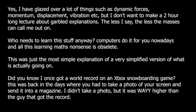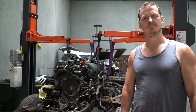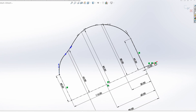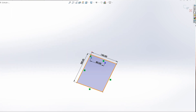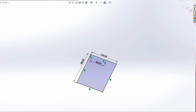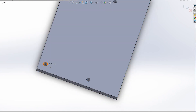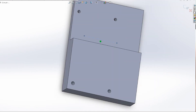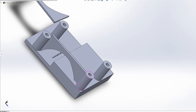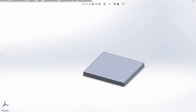Seeing as we know from other videos I'm a walking talking contradiction, I'm going to be ignoring all the advice I've just given — simply because I'm very limited on space on this build. I don't have room to make an angled plate to mount my engine mount to, so I'm going to have to use rotating polyurethane bushes. This essentially eliminates my longitudinal forces, meaning the only forces on these engine mounts will be tensile and compressive. I can probably match the angle of the original engine mounts, but it'll be nowhere near as finessed as the originals.